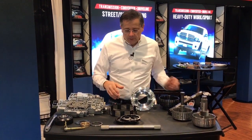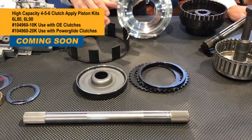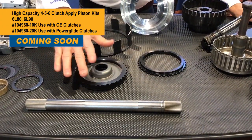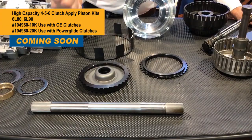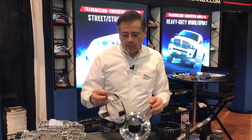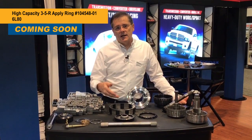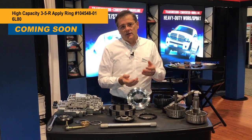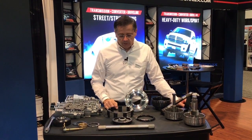Also with the 6L80 for added performance, we've had an improved 456 piston kit for some time, but this is a new version. It has a toothed reaction plate that goes on the bottom, which allows a friction to go in place of the first wave plate. You build the clutch back up from there — basically one additional friction, eliminating the wave plate. And then same with this 35R ply ring: just drop it in, it's a little bit shorter, you eliminate the wave plate and can add an additional friction. These are OE thickness frictions and steels, so you're not squeezing thinner things in there. Both of these add one clutch to the respective clutches.